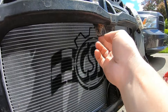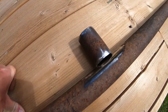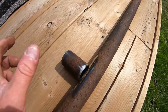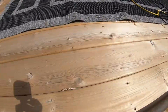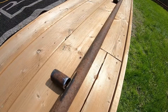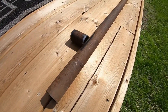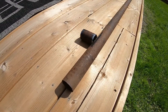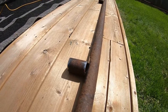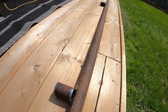I still need to quickly grind the oil cooler area before we get welding. We went ahead and cut our little mounts - the nubs - that are going to go onto the plates attached to the frame. These are two and a half inches each. We cleaned them all up, fresh metal for welding, and cleaned up the bar in the area we're going to weld. Hopefully this all works out. I'm probably going to have to cut a 45 on here but I can worry about that later. We still need to do our tabs for our cooling and get everything powder coated, but slowly but surely we're getting there. Let's get this all mounted on the car.